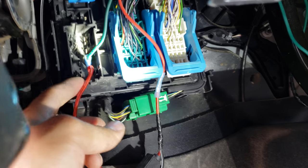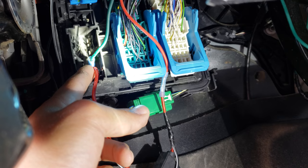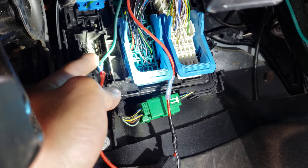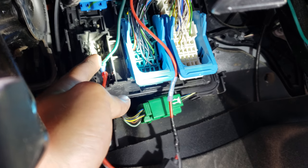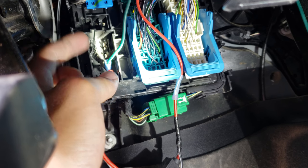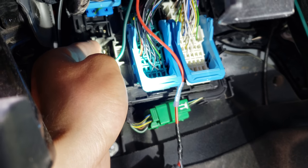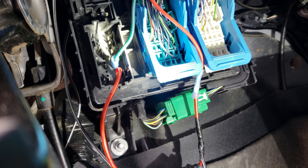This pin here is just an ignition wire — it turns on and off with the key. This is not hooked up to the auxiliary switches; this is just for my cell phone booster and my power inverter. This switch right here is wired up to the auxiliary 2 switch — that is the auxiliary 2 pin and I'm using that one for my rear light pods. Eventually I will be wiring up the auxiliary 1 switch for a front light bar, but right now I'm not doing that, and I've already found that pin.